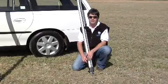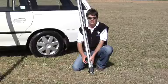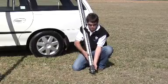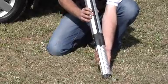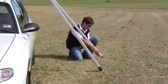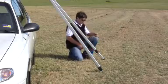Now that both ramps are fitted and lowered to the ground, you can adjust the telescopic leg to get your desired ramp angle. To do this, simply loosen the nylon knob at the base of the ramp and adjust the telescopic section of the leg out, then retighten the knob. When setting up on uneven ground, the legs will be set at different lengths.